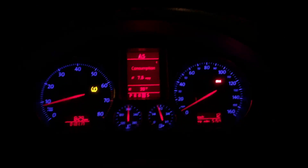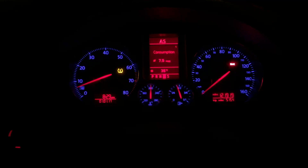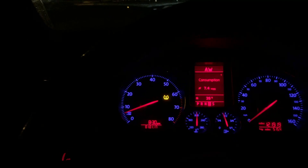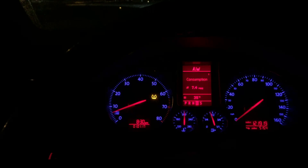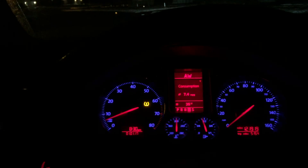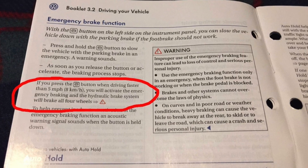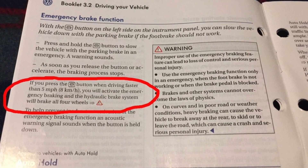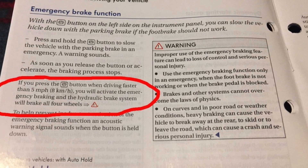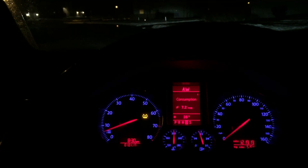It is locking up the brakes as I'm speaking. Without ever touching the brake pedal with my foot, I observed that as soon as I pressed and held the parking brake, there was a momentary delay of about half a second, then it applied the brakes roughly 70 percent — applying both the front and rear brakes. The car came to a complete stop and was held stationary until I released the parking brake or touched the gas.